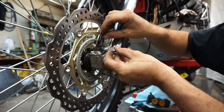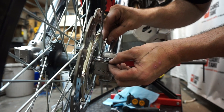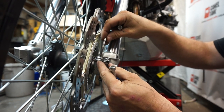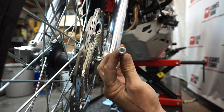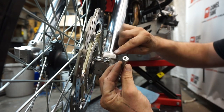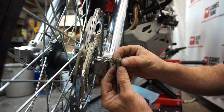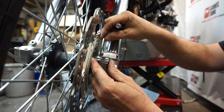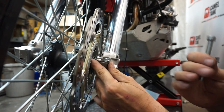The sensor goes in like that, but it wiggles around right now. The easiest way to get this in the right spot is going to be to use socket head bolts and then tack a piece of tubing over top of the head, so that once everything is bolted in, it's located by the tubing around the heads. That's the plan right now.